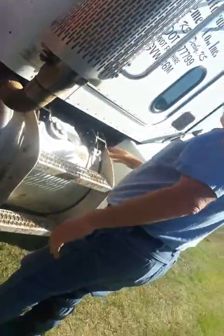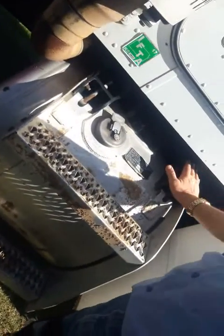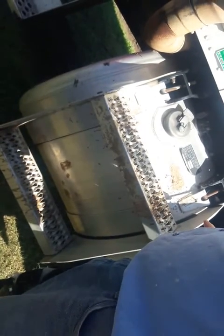All right, you have your fuel tank hangers. Make sure your fuel tank hangers have no missing broken bolts, no cracks, and they're tight. Check your steps. Make sure they're not broken, no missing broken bolts, no visual defects. Check your fuel sending unit wires. Make sure they're properly connected, no bare broken wires.